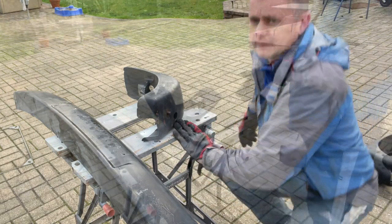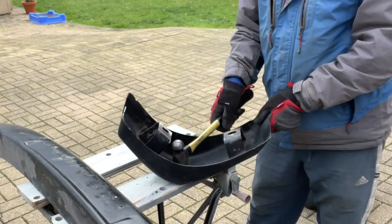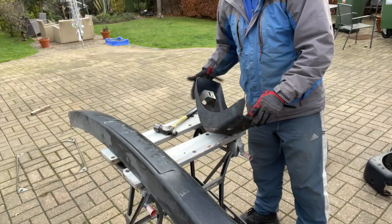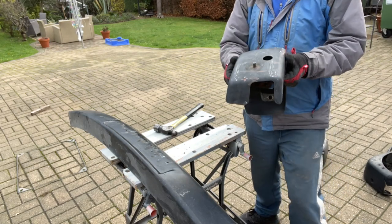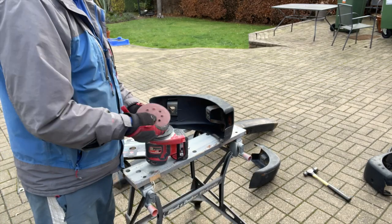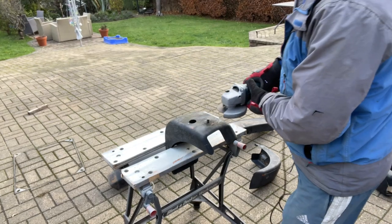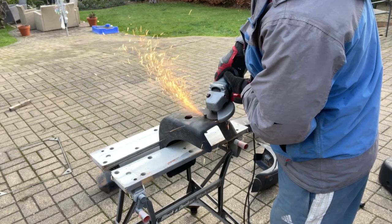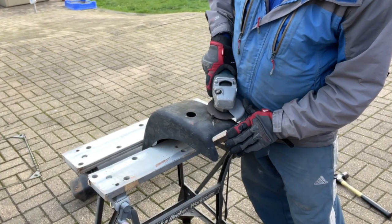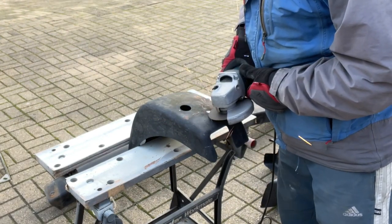The old plastic ones can go in the bin. These new ones do need a little bit of TLC — there's a couple of little dents on there, but this steel is really thick and lovely so we can give it a good bash and it'll just knock out. Up against the work mate there, just to knock these dents through. Try and get it pretty smooth and then once I've flattened it all off and filled any big marks, these will be as good as new. Let's get sanding — I'll pop a decent grit on the Milwaukee sander and try and smooth them out. First things first though, we've got to get rid of these two threads poking out through the back of these bumpers, used for fog lights. They've been welded through, so I'm going to grind them off and cut them with this cutting disc.